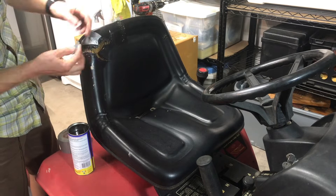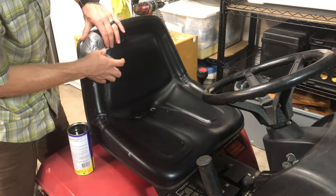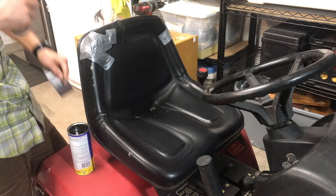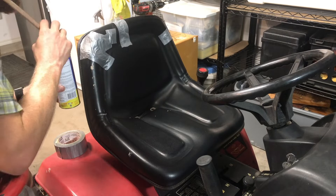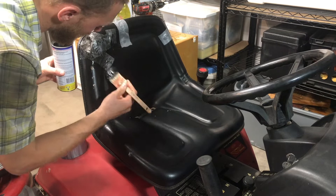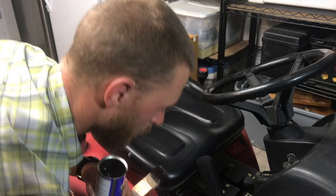So on to part two. I got some duct tape and I'm taping over the stitching, making sure it's super flat with no bubbles, intentional about where it goes, and following the contours of the seat. It's really important that we got the seat clean with rubbing alcohol so the duct tape adheres properly. Now that the duct tape is covering the major holes, we lay Plasti Dip on top. We're going to do quite a few coats — the first one you want about 50% coverage and then spread it out, going a little past the duct tape to feather it in. I did about six coats total until it was fully covered.